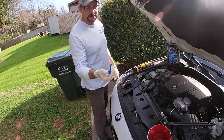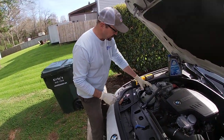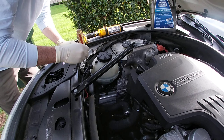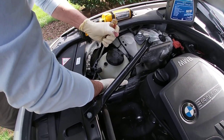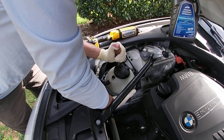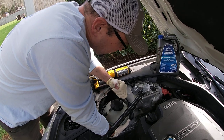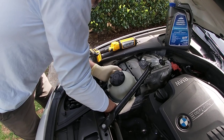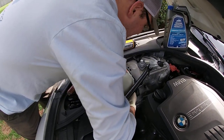This is what the sensor looks like. I've got the new part here, and the coolant level sensor is at the bottom of the coolant reservoir. So to get to that, you have to undo these tabs — just push back on each tab. That's what's holding it in place. Now the coolant reservoir is popped out and I've got access to the sensor.